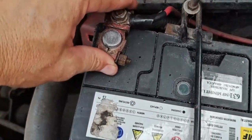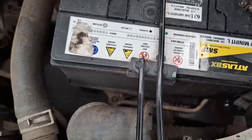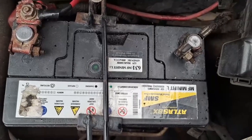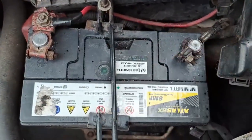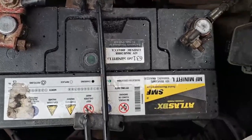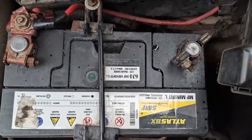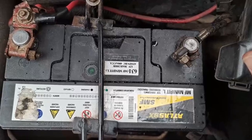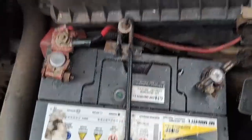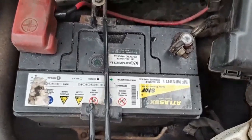It's on. None of them are moving, so they are 100%. Other than that, you can get a nice spray that you can put on to protect it from that acid buildup. But other than that, there's nothing you can do for the battery — it's a sealed unit, so you can't replace the battery acid. If by tomorrow morning the car doesn't start again, then it's obviously not the contacts or terminals, and the problem lies with the battery itself — then I'll have to look at replacing it as soon as possible.